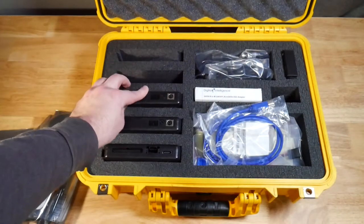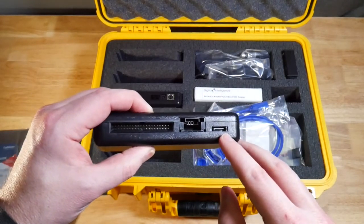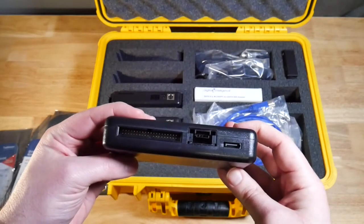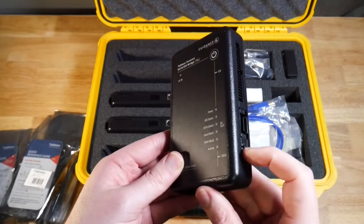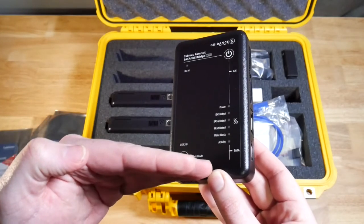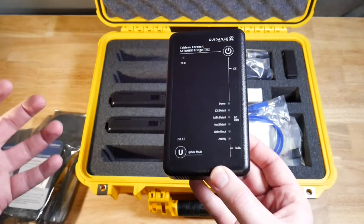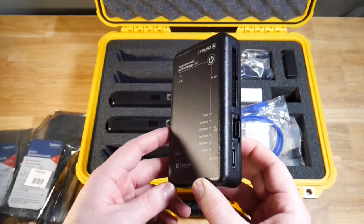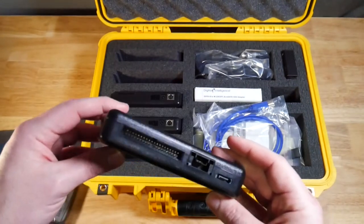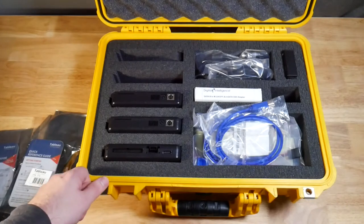So those are our three bridges. Basically, you have some sort of connection coming in, a connection going out to your forensic workstation, and power — that's it. The whole idea is that we want to be able to read from the source device but not write anything back to it. That ensures we can make a disk image and guarantees we're not writing any of our own data to that source. I always recommend using external write blockers like these because they're easy to share among a lab and even take with you on a scene if needed.